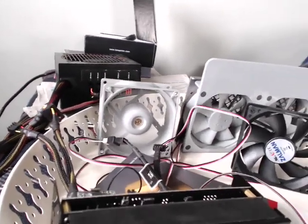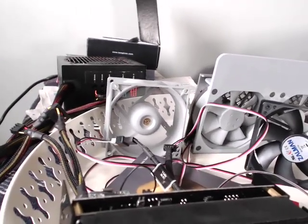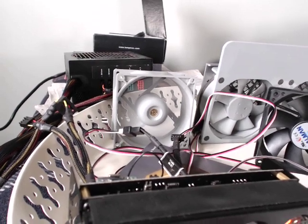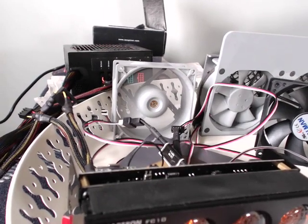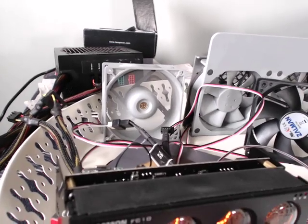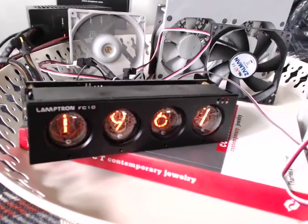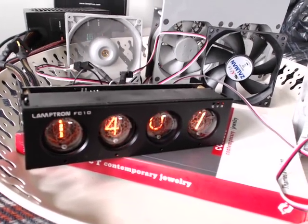You could swap out the smaller ones as well. I've just swapped out the 92mm fans here, but obviously if you decide to swap out the internals of a 60mm fan for the PSU, or you decide to swap out one of the 80mm fans in the hard drive area, or in the front, the one next to the speaker, they should all be doable. Just select the right fan to change the internals out with, and you gain a good degree of controllability, because any old fan controller then will be able to work them.